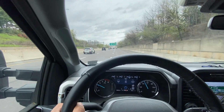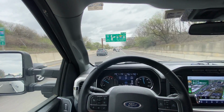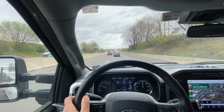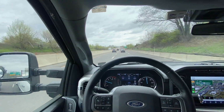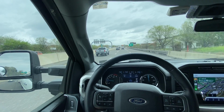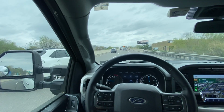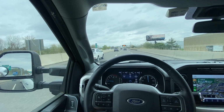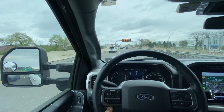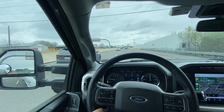And in our case, again, it was a 3.73, which was really overkill for that truck, because that truck had so much power, so much torque at such a low RPM. You didn't need a 3.73. It didn't need that much leverage over the rear wheels. It had all the leverage it needed, and so really it would have been a lot better with the 3.55, which you get in the two-wheel drive Power Boost. And it would have been just fine with this final drive, which is a 3.31 in this diesel F-150. But that thing was a monster. It was an absolute monster.